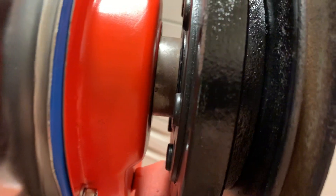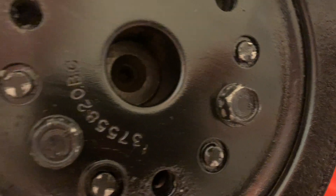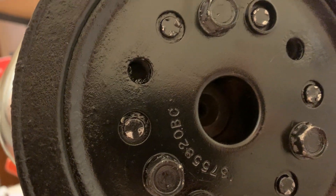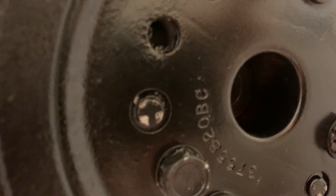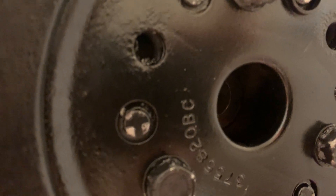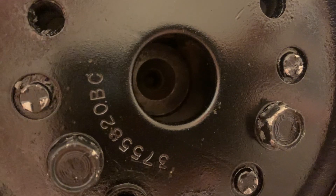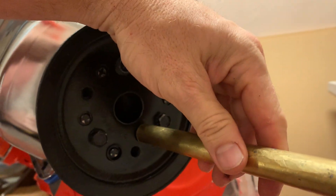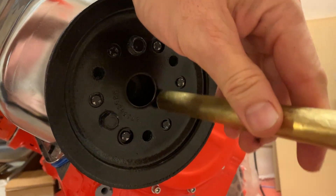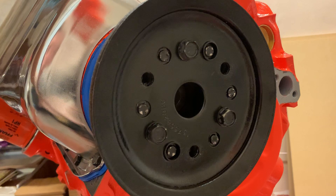I felt like I was bottomed out, and the distance looks about right compared to what it originally looked like. I put a little oil on it before doing this. Then I went inside with a flashlight and could see that the wear is different where the shaft doesn't hit compared to where it does. Where there's no wear from the crankshaft being on it, I can see the older-style dirt and debris — meaning the part was clean but unworn there. That told me I was pretty much in the right spot. I also hammered straight down on it with the drift to confirm a nice solid sound, and I'm confident I got it on there correctly.